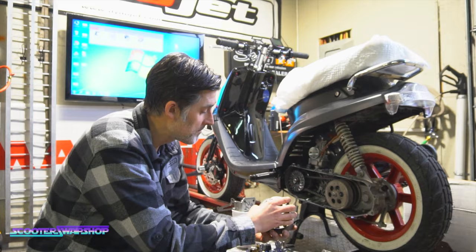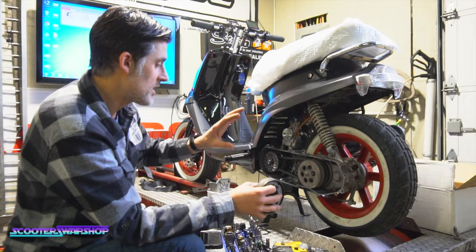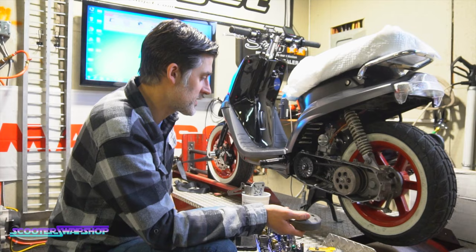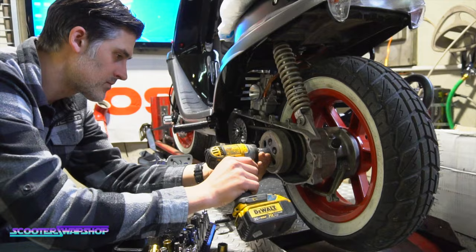So when this starts to move out, it's instantly going to grab rather than having a little bit of time before it comes all the way out and grabs. So this should be pretty easy. I'm going to get the CVT closed because we pretty much know where it needs to be, and then run it on the dyno because he said he thinks it has an air leak. However, it tested good. We'll run it on the dyno, watch temps in here, and run it up to verify it's good. This should be a pretty easy fix, but I just want to show you the importance of having the right CVT components and being able to look at this and tell basically what the issue is.